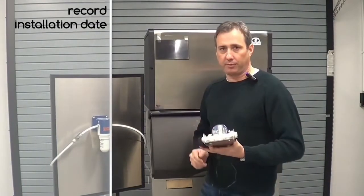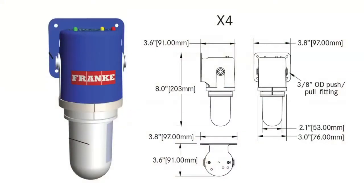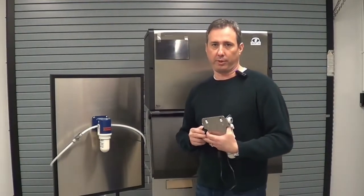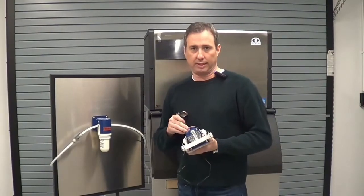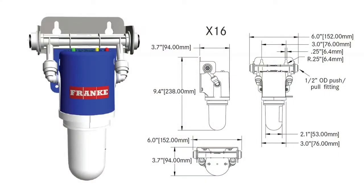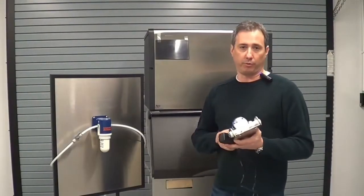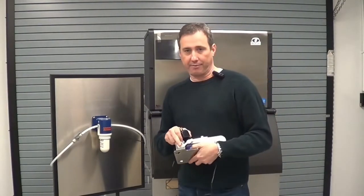As you can see, we have two different models of Eco-Ice. We have the X4 model, which you see here, which fits most all ice machines on the market. It has a 3/8-inch inlet and it accommodates water flows between 1.3 and 4.9 liters a minute. We also have a high-flow unit called an X16 that works on high-flow ice machines like Hoshizaki and some other very large machines. It accommodates water flow from 4.9 to 16 liters a minute and has an inlet of half an inch on each side.